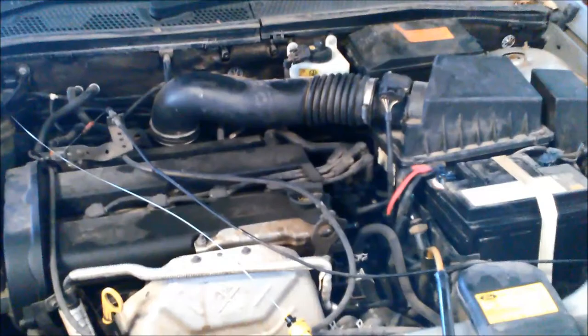We're going to suck the oil out of the transmission with our vacuum pump through the filler tube. This pan has been off recently by the dealer — you can see they've siliconed the pan onto the transmission instead of using a gasket. I've also put strong neodymium magnets on the pan when I took it for a test run, just to get an indication of how much metal is floating around in there. We'll take the pan off now and have a look at what's going on inside.